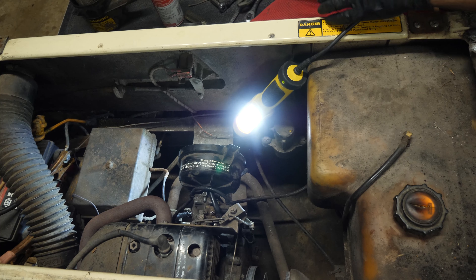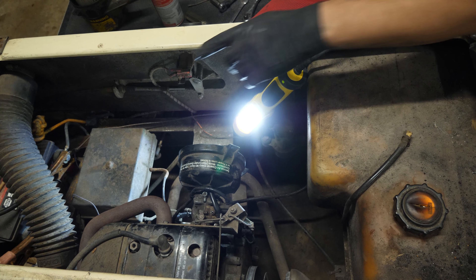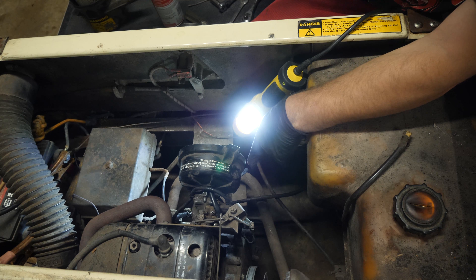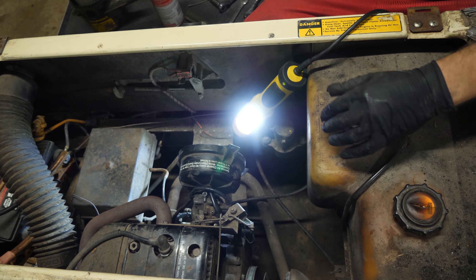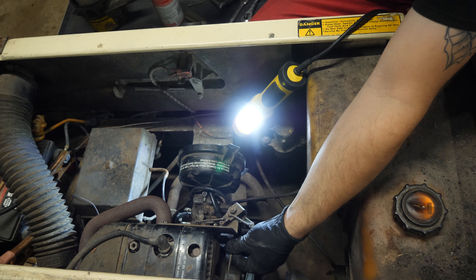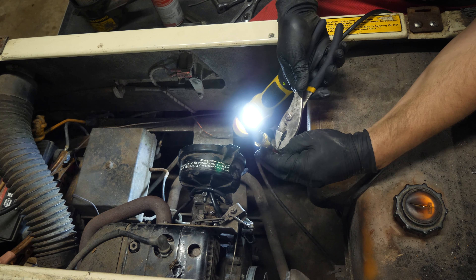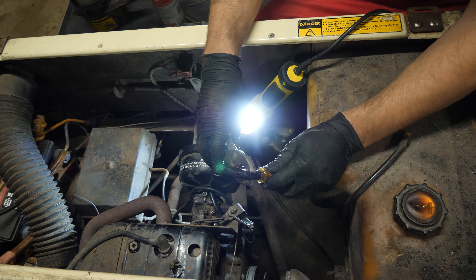See how when I step on the pedal, I can see the governor — this is the governor from the rear end — it's disconnected and you see the pedal goes through this box, runs through a little cable. There's this arm that's connected to the side of the motor, and you can see it pulls this arm out, pulls this linkage here, then opens the throttle. And then at the same time, it pulls and pushes on this rod here, which goes back to the governor in the rear.